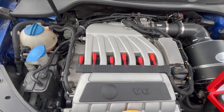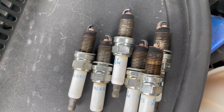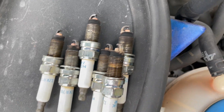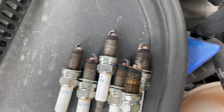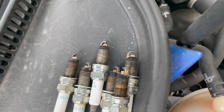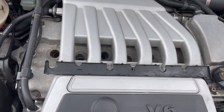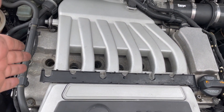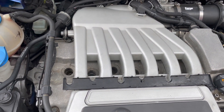I've just got to whip out all the plugs and the coils. Once the compression test is complete and we don't see any issues, I'll take you through the plan of how I'm going to tackle this build. I got all the spark plugs out - they don't look too bad, a little bit caked up, but they are new-ish, put in about five or six thousand miles ago. I got all the coils off too. I'm going to start with this cylinder, work my way across, throttle wide open, and see what the pressure is.